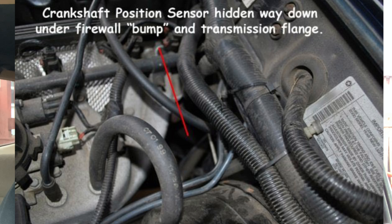Number one — if you've owned a Jeep, you know the crank position sensor on these things goes out. I know a lot of people that will change everything under the hood, but they will not think about the crank position sensor. When that thing usually goes out, you'll be driving to the gas station or the store. It'll run fine. You go into the store, do what you got to do, you come back out and this thing will just sit and crank and crank. People beat on the gas tank, they'll change sensors out there, but one thing they always overlook is the crank position sensor.